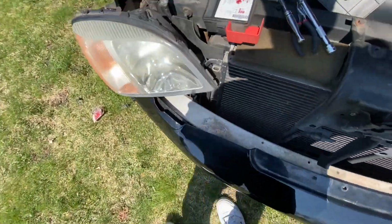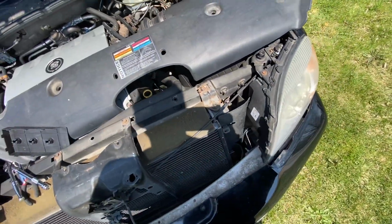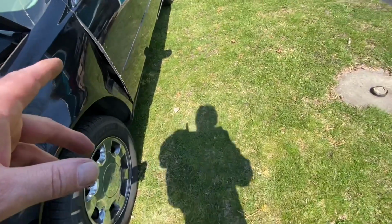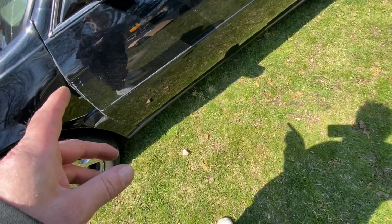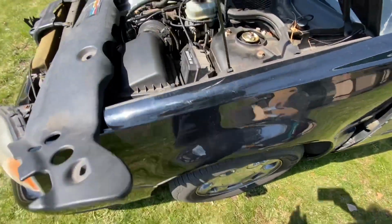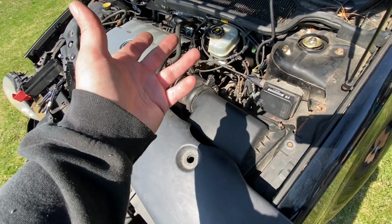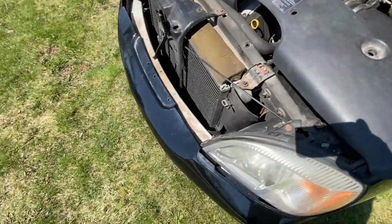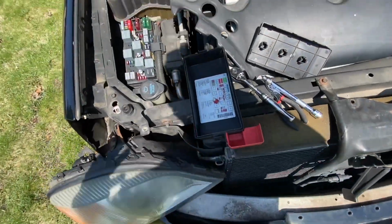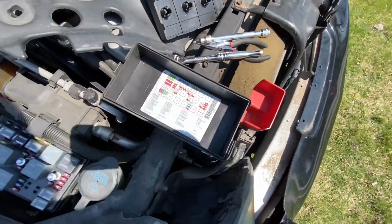Okay, so we've been having trouble with oxygen sensors. I changed one sensor, which would be bank 1 sensor 2, the one after the catalytic converter. That one got changed. I did get an error on this one, but it's telling me I'm getting voltage to it. And now I just found out, reading up on it, that there's no fuse. It comes from the PCM module.